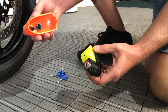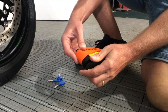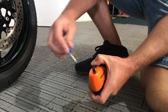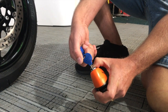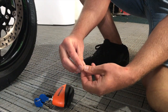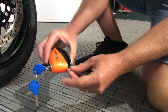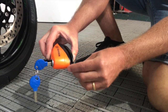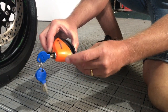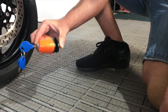The cover's got to go back on then — slide it in at the back and over at the front. It's a bit fiddly but it clicks over. Once that's in place, you're then going to have to insert the key and turn it in a clockwise motion, which will release the pin back up, because we need to put the grub screw back in. Pop the grub screw back on the end of the allen key, insert it into the back and screw it in — this is holding the cover over the top. Once you've got it all the way in, don't over-tighten it, just nip it up. Allen key in a safe place — that's that bit done.